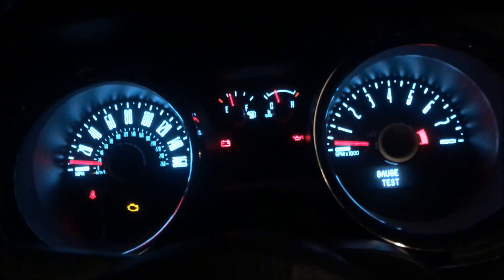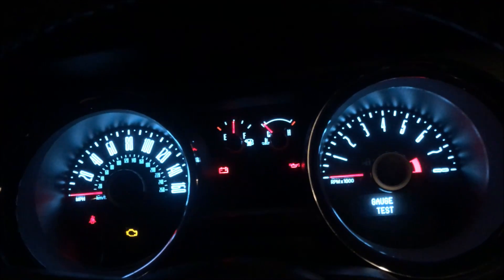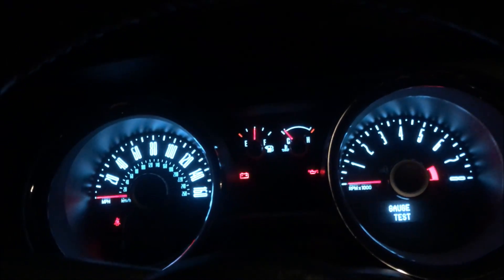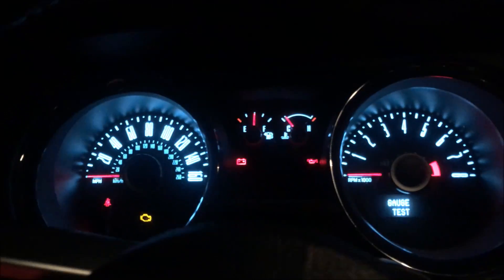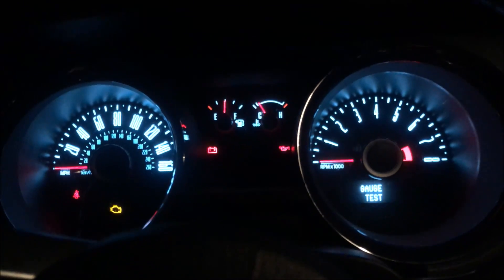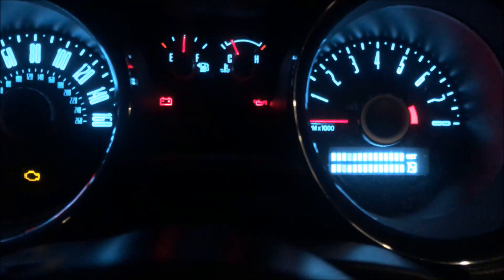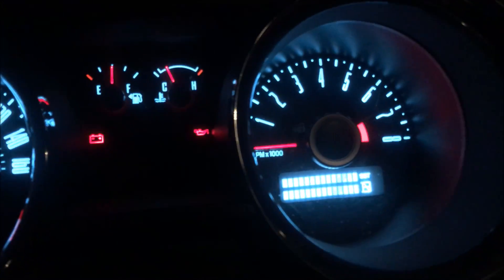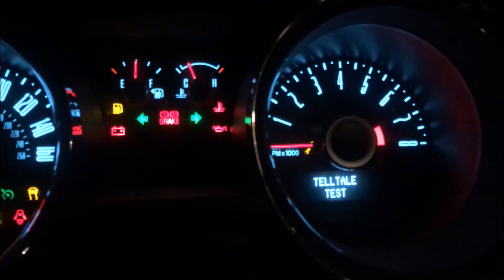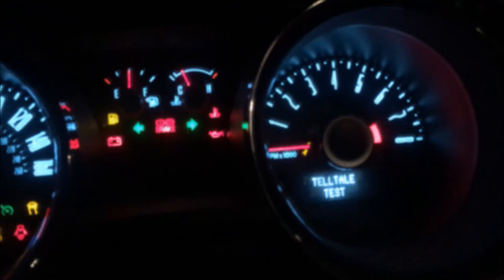From here, what you can do is continue to hit that reset button and it's going to take you through all the different tests and things that you can do in engineering mode. Just going to go through a few of them real quick because there is a lot — I think there's over 40 or 50 different things on here you can go through. Some of them are really cool, some of them are useless. This is the next thing that's going to pop up after the gauge test — telltale tests. You're going to look at all your bulbs in the dash, make sure everything's illuminating properly.